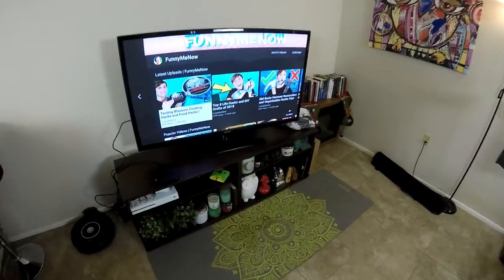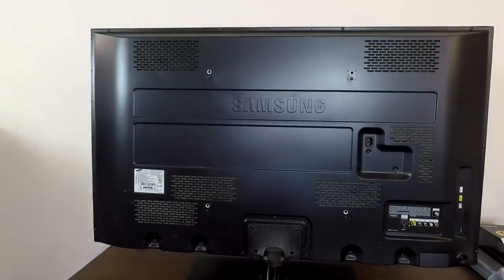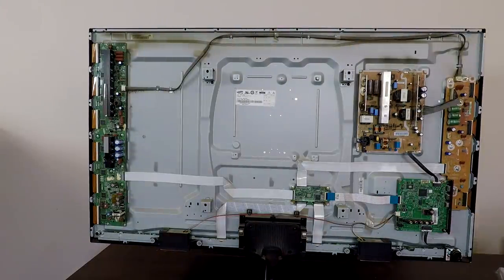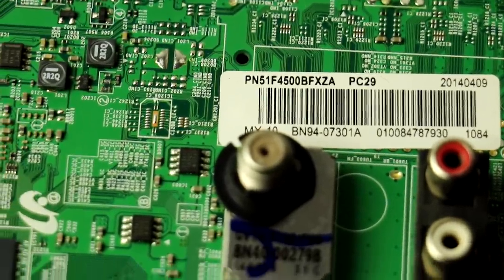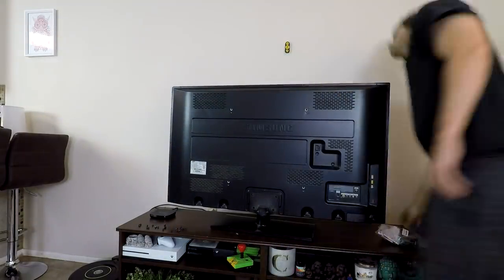For this next hack I'm going to show you how to fix the HDMI and USB ports on pretty much any TV. This is my TV — I've had it a while but I've been pretty rough on it, and the picture gets weird if I have multiple things plugged in at the same time. I'm going to completely replace the main board, which is a lot easier than you'd think. Just unscrew the back cover and get the part number for what you need to replace. If you're having trouble with HDMI or USB ports, replacing those parts usually fixes the problem, and they're all connected to one board. Type the part number into Google or eBay, order a new one — I got mine on Amazon. Then just disconnect the wires, remove the screws, take out the old main board, screw in the new one, and connect all the wires. It's basically plug and play. Check that all ports work before you put everything back together, and for me it did.